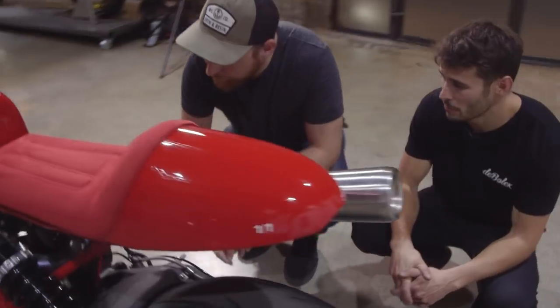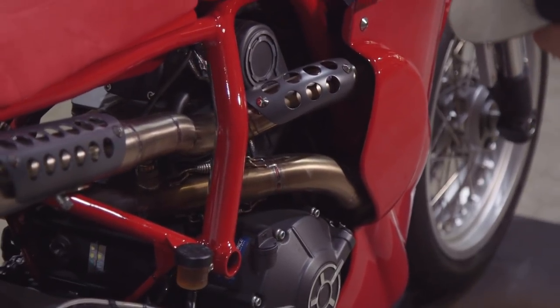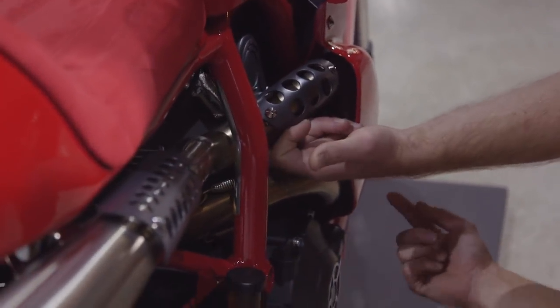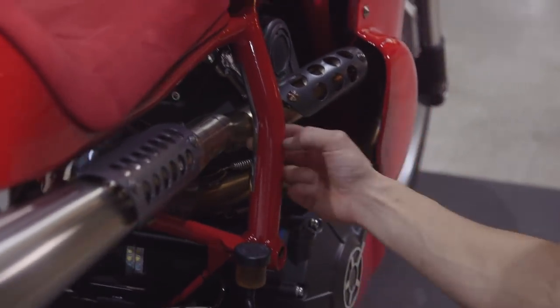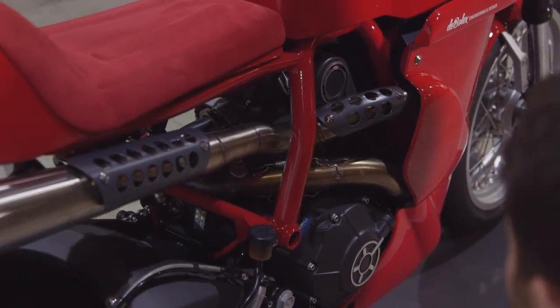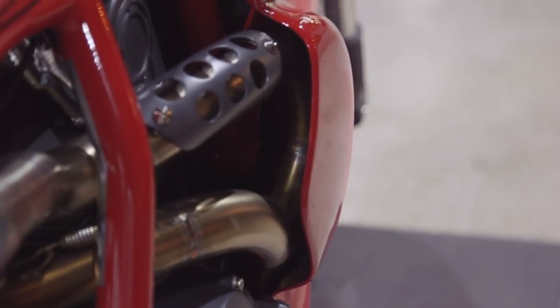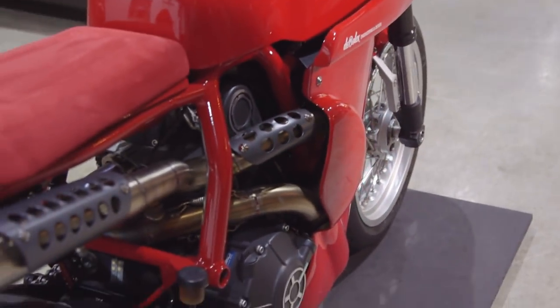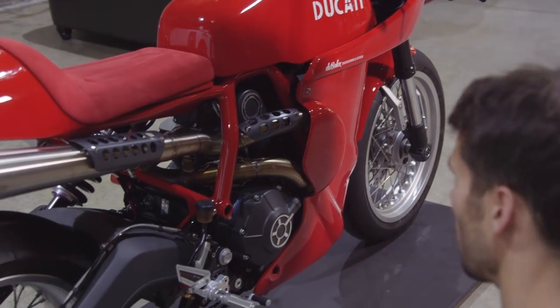The headers are all our work — from the headers back, that's all us. Stainless steel bends which we buy in and fabricate into shape. It was really tight getting through this frame. We wanted a high exhaust, so the challenge was getting two pipes curling up and around. That bend radius really hugged around the frame quite nicely. There's a beautiful loop under the bodywork there — that's to match the header lengths, which we're quite particular about. Putting the collector centrally worked out perfectly to loop back round and get up high for the pipe.